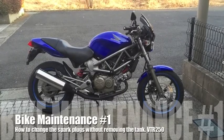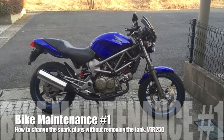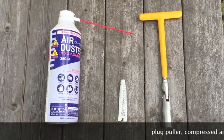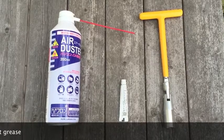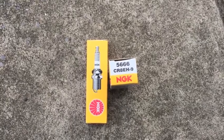In this video, I'm going to show you how to change the spark plugs on the VTR250. Make sure your engine has cooled before you start. The tools you're going to need are a plug puller, compressed air, and some grease. You'll also want to get a couple of new spark plugs. CR8EH-9, NGK are what I'm using.